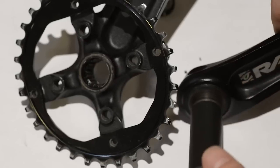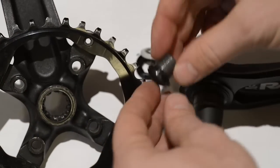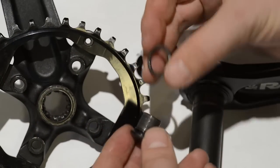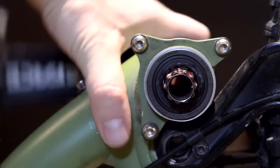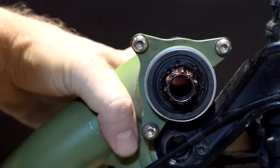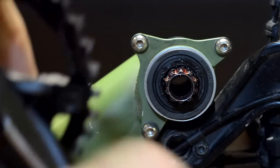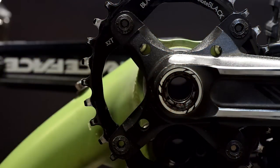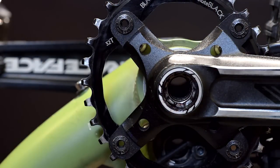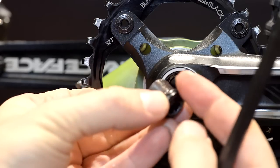Like I mentioned, I also apply a bit of grease over there, and this is your cap, and you also have a little washer here. As you can see, I applied a generous amount of grease on the spindle teeth, and I also applied some over here on the thread. Orient the cranks properly — as you would expect, the opposite of one another. I'm ready to reinsert the 8mm bolt. I have the washer right here.